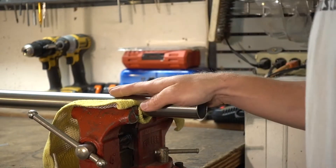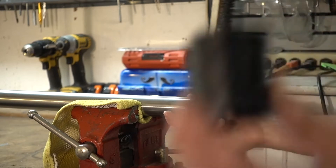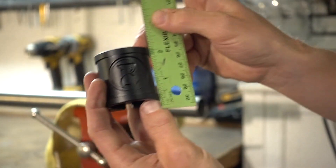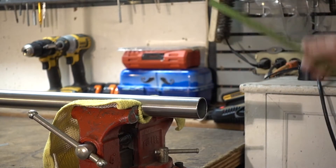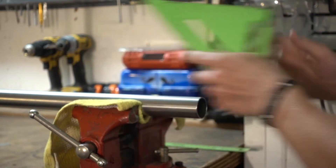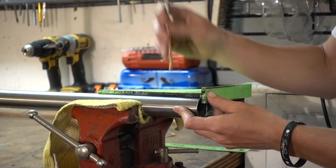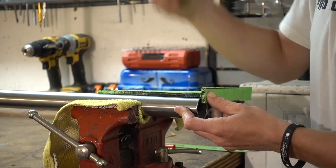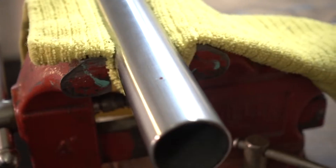Before we make the first mark, we need to know what clamp we're riding. This pair of bars is going to be on a Rapture clamp, which is 1.8 inches tall — you can measure your own clamp at home to find its height. Since the clamp is 1.8 inches, our slit should be no taller than 1.7 inches. I'm going to put the dot at 1.5 inches, because when we drill the hole, the drill bit will go slightly above that, making up the perfect difference. So we'll grab a marker and make the mark on the side of the bars at an inch and a half — and I can't stress this enough, the slit needs to go on the side.